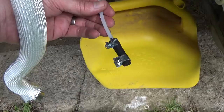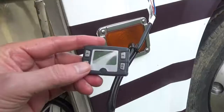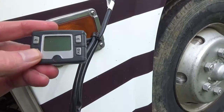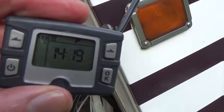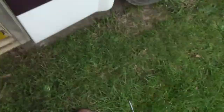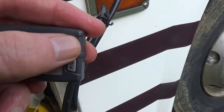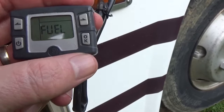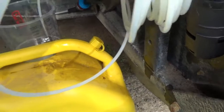For testing I'll just clamp it onto a battery. Like in my testing before startup, I'm going to run some fuel through it using the fuel-only setting on the controller. I need to turn the pump on on its own by going to the timer screen — the clock — then pressing both top buttons at once to get to the program menu. I'm on P1, I change to P2 and select OK, and it goes into a fuel pumping mode. The pump is running and all I'm trying to do is get fuel to come right through the line until it's coming out the end.